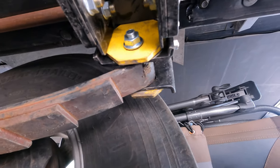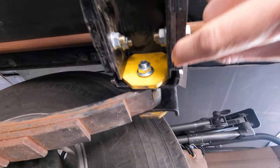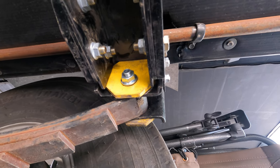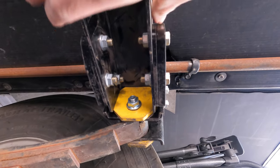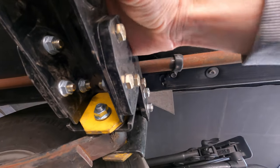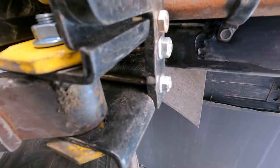That's what's providing your lateral stability for the X-Factor cross member. It is bolted on with three bolts on either side of the U-channel. There's an extra plate here — this line is not a crack, it's actually a separate plate because this U-channel on one end is slightly narrower to fit inside the U-channel on the other end. These plates are just spacers so that this doesn't warp or bend as you tighten things in place. Each of these bolts is tightened to 40 foot-pounds. These longer bolts — four and a half inches long — that hold the side plates to the spring hanger are tightened to 26 foot-pounds of torque.